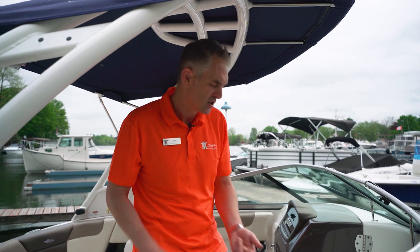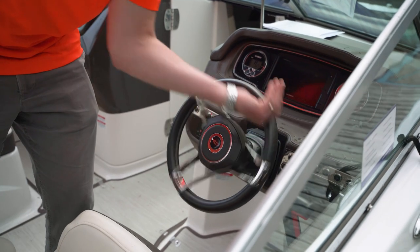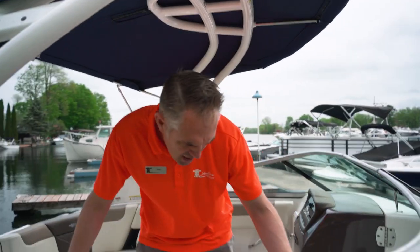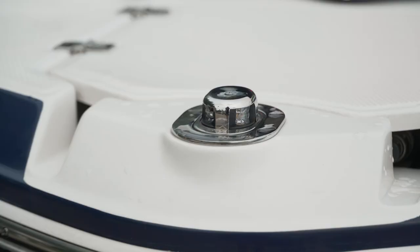Now that we have the battery hooked up and made sure it's clean and ready to go, we're going to do a quick systems check. The most important things: we want our navigation lights to work, we want to make sure our bilge pump is functioning, and we want to make sure the horn and all the safety gear is working properly and the engine is going to start and steer. I start it up, make sure it's going to run fine, and make sure it's pumping water — if you see that telltale stream of water coming out you'll know the impeller is good. Check the steering to make sure it's smooth with no hang-ups or rough spots. Then I'll turn the engine off and check the lights and the horn. Horn — working well. Bilge pump — you have to sometimes listen; yep, I can hear it. Then check the navigation lights and make sure they're working correctly.